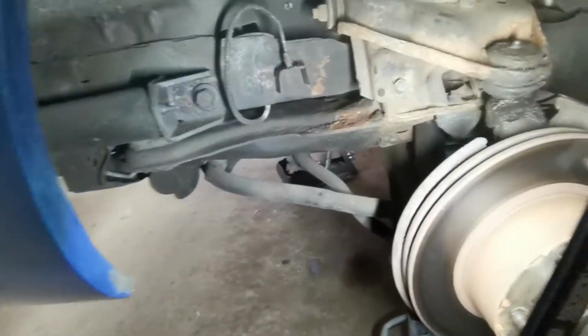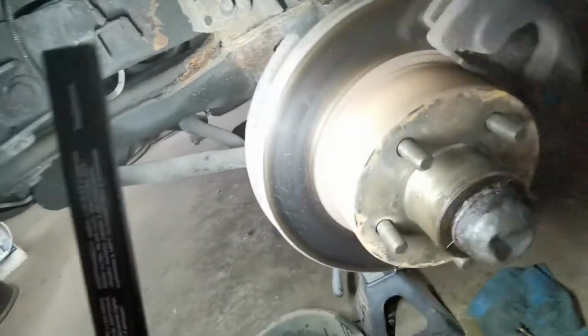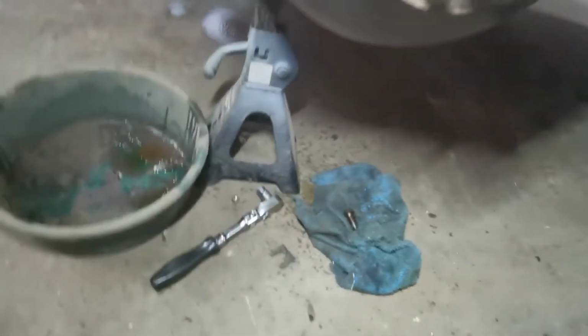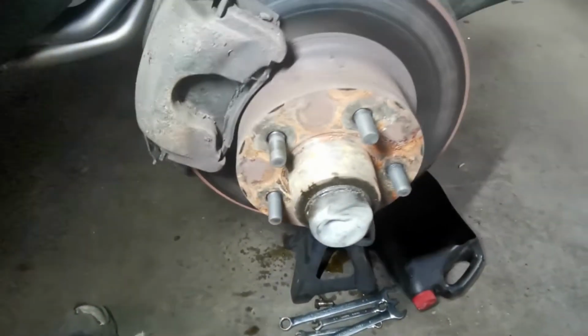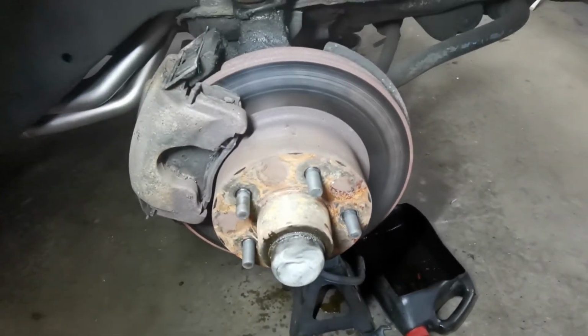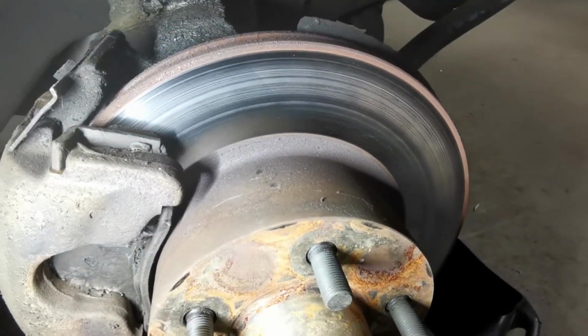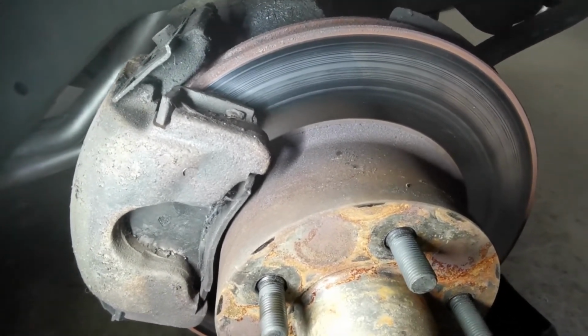Okay, welcome back here. So I've let everything cool down, and I went ahead and I pulled the brake hose off. You'll notice on this side, you can still kind of see a bit of the crosshatch on the rotors, and they're still pretty clean. They've gotten hot at some point, but not that hot. So I've gone ahead and I pulled off the hose on this side. And on this side, which was the offending side, it's hard to tell, because obviously this isn't smell-o-vision, but all I can smell is hot brake on this side. And what you notice here is, see that banding? This side hasn't been working properly for quite a while for it to do that.